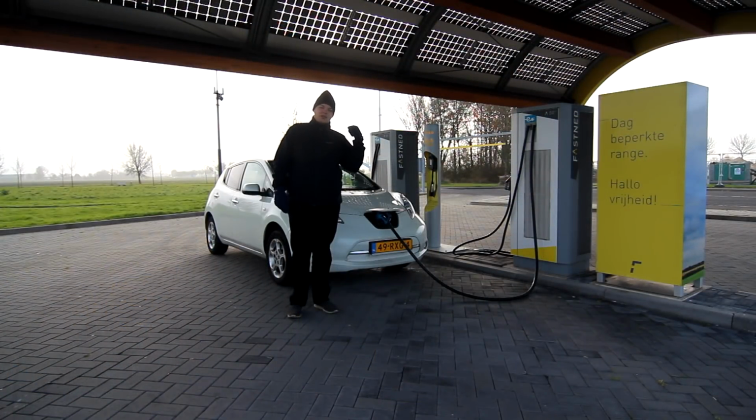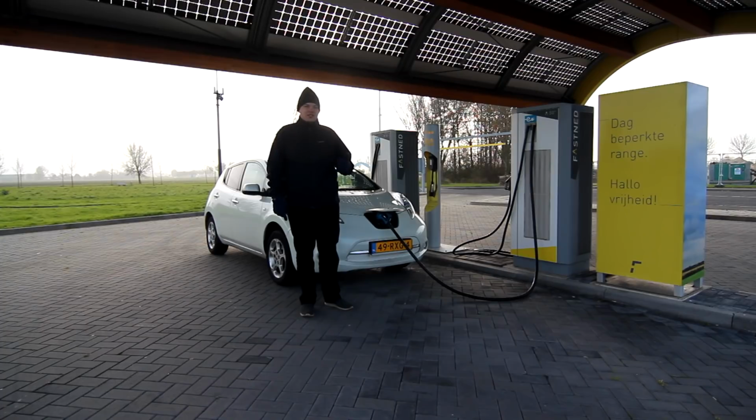This PCB has to work together with the control PCB that is in the battery box, that does charge management and balancing of that battery, and that part I have not implemented in this car yet. So I am currently dead reckoning the capacity of the extended battery and adding that to the main battery, and it's not quite working yet. Specifically, when I accelerate very hard or when I regenerate very hard, the estimated range goes up and down quite wildly. Even though I've got the SD card drivers and everything working, there is no permanent logging on the car yet. First of all, I haven't even installed that board in my car. It's just on the bench right now, and it's doing other CAN logging. So I still have to put that in my car, pull out logs, and do stuff with that.